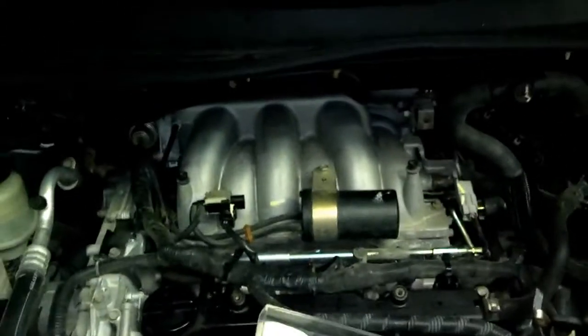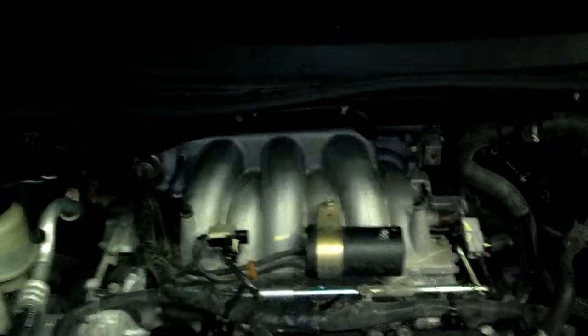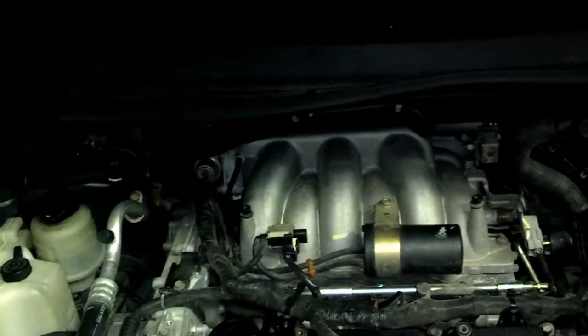I've already completed that project, but I've got an intake gasket leak on the upper intake. After I put all this stuff together and cranked it up, it didn't run too great to begin with, and it sounded like it was getting worse. I started checking around the back and the front, and you can hear this intake just sucking air. There's only one vacuum line on the back that goes to your brake booster, and that was not it, so I made the determination to look further.